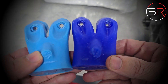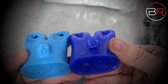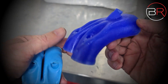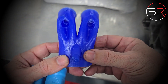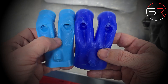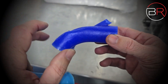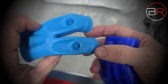Now you can see the finished result. The guide fins have big radiuses — these shark fins are far better profiled now to guide flow around the valve itself. The entry into the window has much better cross-sectional area. Core shift is fixed and we've put some nice shape in there. The divider is now a proper knife-edge, removing a lot of mass and gaining more volume in that area. We also moved the wall out a little to give more CSA at the choke point of the port, thinning all that down.